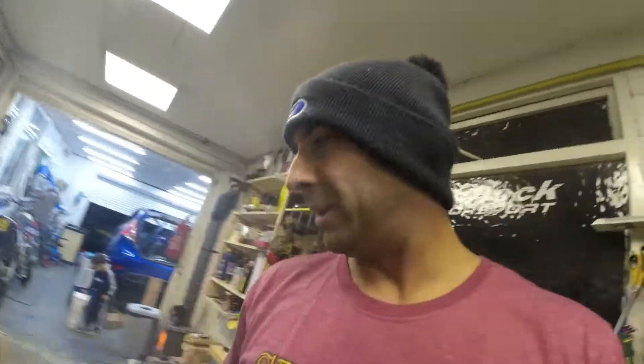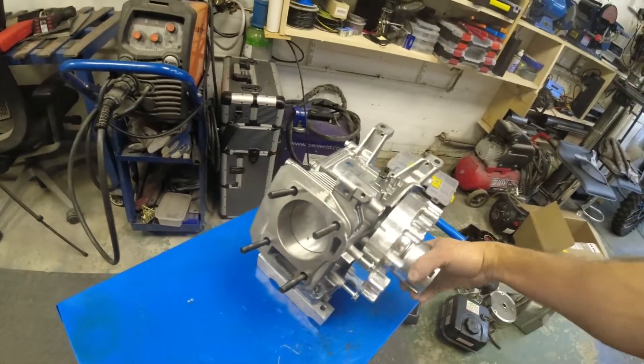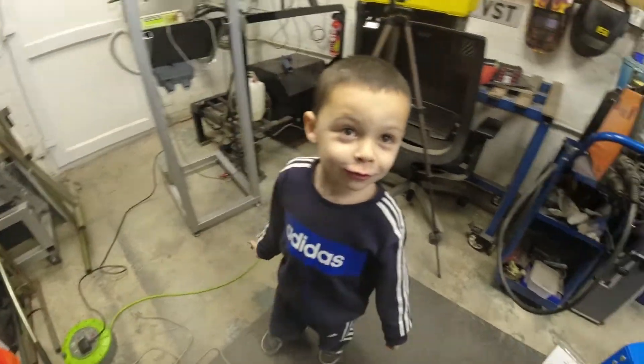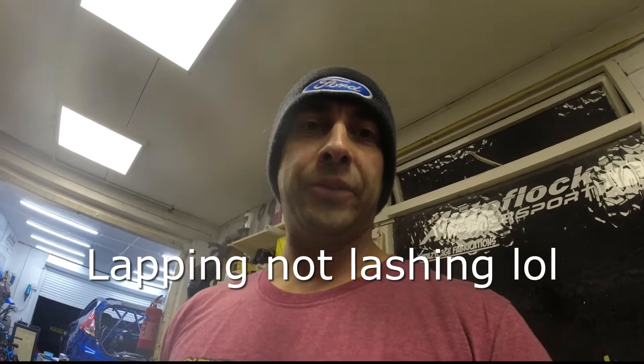So that's the short motor built — all sorted, torqued down, and spinning super freely. I'm actually quite optimistic about this engine build; it feels really good. We've got the head studs in with blue Loctite. The bottom end is all done. Next is the head gasket and head, but we've got to do the lapping of the valves into the valve seats first. But yeah, that's the end of this video. Next install we'll see the top end going on, and I might have some dyno results. Thanks for watching — see you soon!